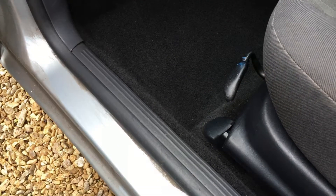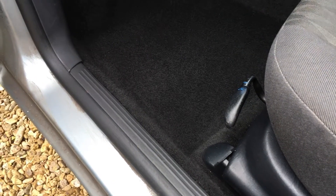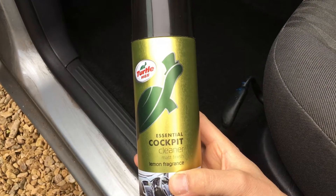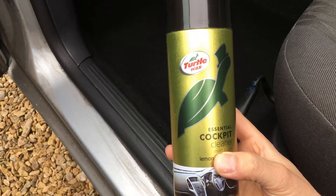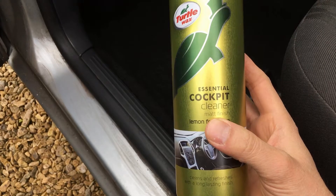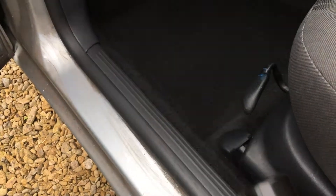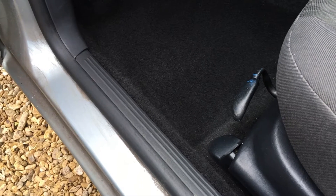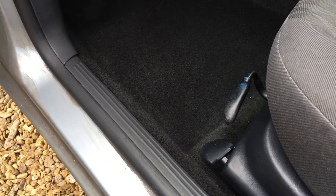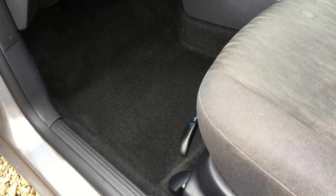We've cleaned all the plastics and the Focus is looking better, but some areas still look quite faded. On faded plastic areas we want to restore the color with a plastic color restorer — this is a Turtle Wax one, but others are fine too. The important thing is to use the matte finish version; the gloss finish just looks too shiny and tacky. Spray it on and then rub it right into the plastic with a clean cloth — you'll get a better-looking finish that will also last longer.